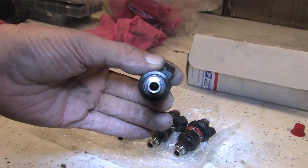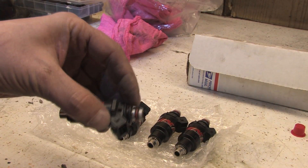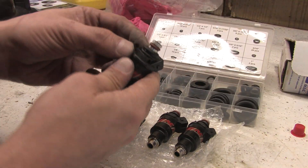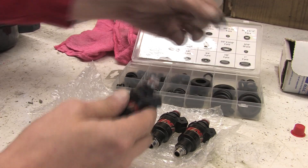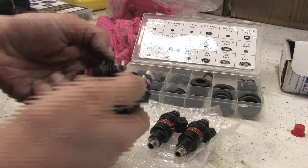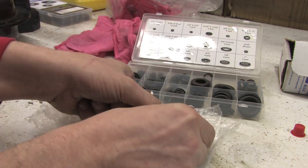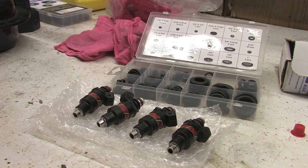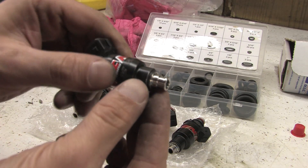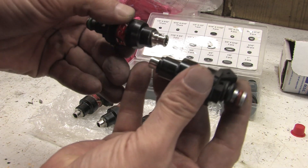My old injectors have a four-hole recessed ball-and-disc jet. The tops of the injectors are also very different. I've gone with bigger, harder rubber grommets as upper injector insulators rather than the thin, flimsy rubber ones. I found that putting a little extra pressure on the upper insulator prevented boost leaks at the lower seal, and this cheap rubber grommet did exactly that. The lower seal buffs on these PL4s are grooved for whatever reason, and I don't understand it — I don't know what to think of them yet.